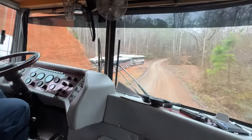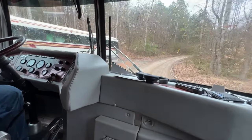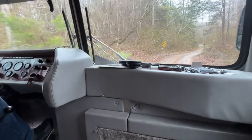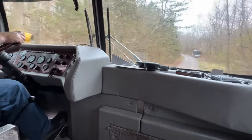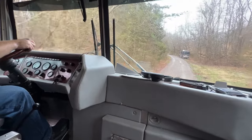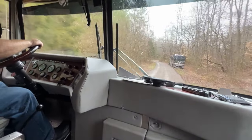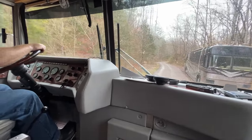Oh, that doesn't work on this hill ever. What did, well, I guess your RPM's 2000. Yeah, that did. It's on. It just kicked on. All right, is it a momentary switch only? It is. Because I swear I just heard it. It is. It's momentary. So you have to hold it if you want it. So maybe it was still open because it takes a few seconds for it to turn back off. Okay. Because it's done by oil pressure.